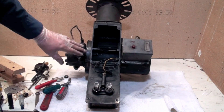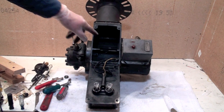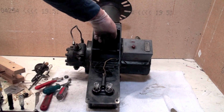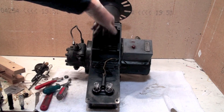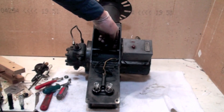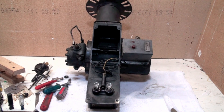Here we have a view from above on the blower assembly. I want to take a look at this before we get that nozzle or the gun assembly in. Now this is the way this should turn — it isn't perfectly easy to turn, but it should turn reasonably easy. These blower fins here tend to get a lot of dirt in them and eventually they're going to need to be cleaned up.